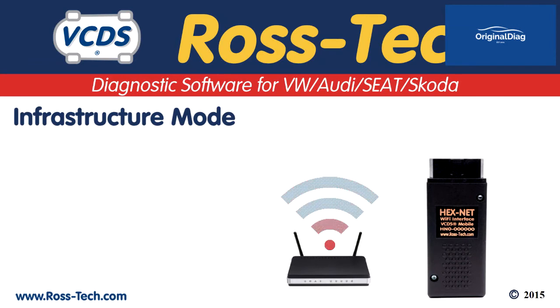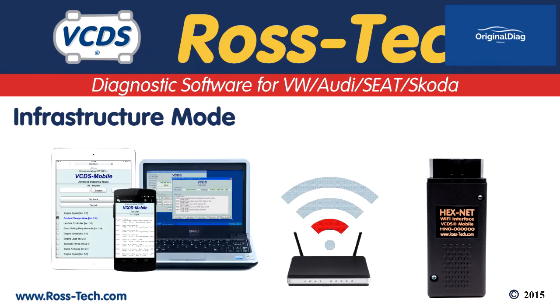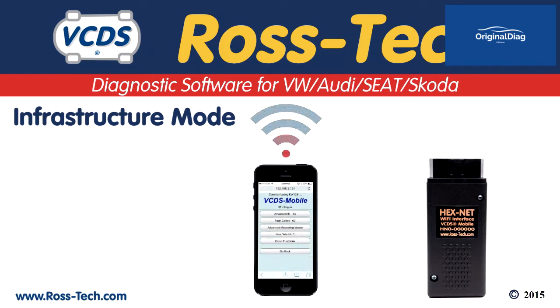In infrastructure mode, the HEXnet is connected to an existing wireless network. Laptops, tablets, and smartphones on that same wireless network can connect to the HEXnet. If your smartphone can be a Wi-Fi hotspot, then the HEXnet can connect to the hotspot in infrastructure mode.